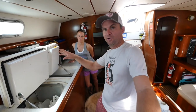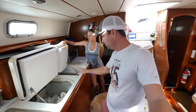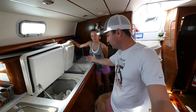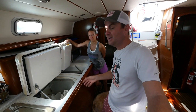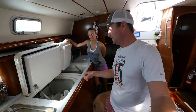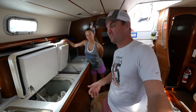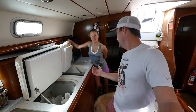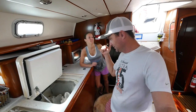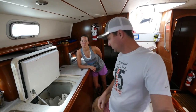It's not like your household refrigerator, which works kind of like an air conditioner — it blows cold air in. This doesn't do that; it just has a cold plate and ambiently cools the refrigerator. So if you put a bunch of hot air in there, it takes a very long time to pull it out. That's why you shouldn't put warm things in your refrigerator — don't put a warm case of beer in there; it will warm up your refrigerator.